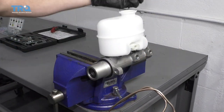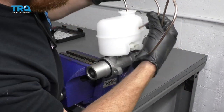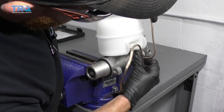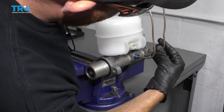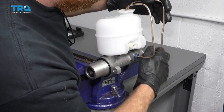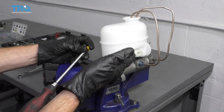Take off your cap, line up the fittings to their corresponding holes, and screw them in completely tight — use a wrench at the end. Do the same to both. Now that you have your lines on, fill it up with your DOT 3 brake fluid.